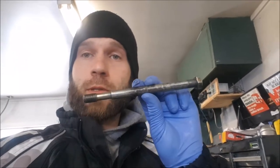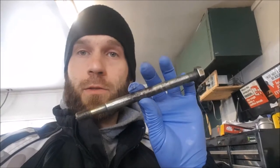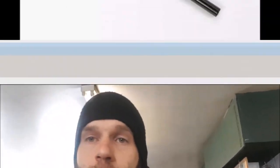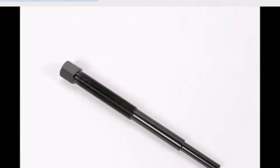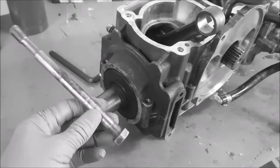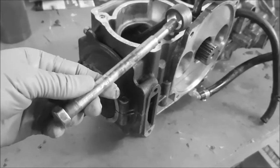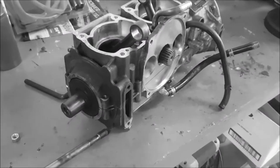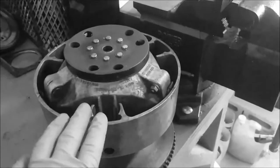If you're having issues taking off your clutch using the water trick, chances are you might have the wrong bolt. To get the proper bolt — you can't use the clutch bolt that looks like this because there are no threads up on the end to pull the clutch and create hydraulic pressure down in the bottom. We got our clutch off. I just made another video about doing the water trick with the wrong style bolt, which didn't work. I'll try and throw the link in the description so you can see the issue I was having trying to pull my clutch off.